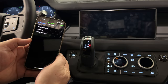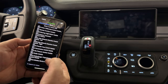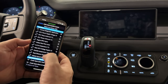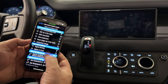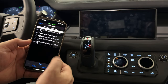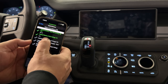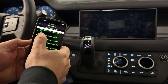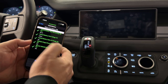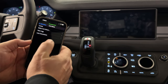I do like this one — live values. I have found that this shows a lot more values than my standard scan tool will show. You can go through here, find an ECU that you want to look at, and then it will show you all the different values that that ECU can output. Under live values you can also create favorite lists. I have made one for my hybrid battery so I can actually go in here and look at the values. It's saying that my hybrid battery pack has 96.5 percent life left and it's at 45.98 volts right now. This is very useful information that shows you things a regular scan tool can't.